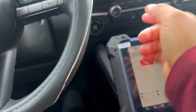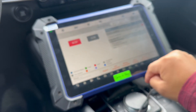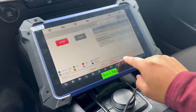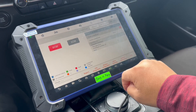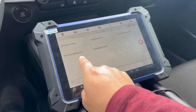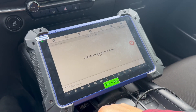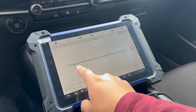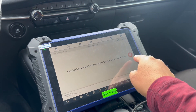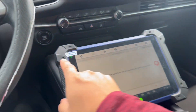Since you don't have any keys, you won't be able to turn the ignition on. So the way you're gonna turn it on is you go to 'remote learning' right here — remote learning, keyless system — and then we're gonna turn the ignition on. It'll automatically tell you: if the ignition cannot be turned on, use this function to turn it on first.